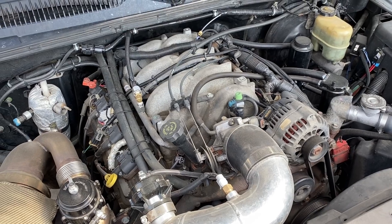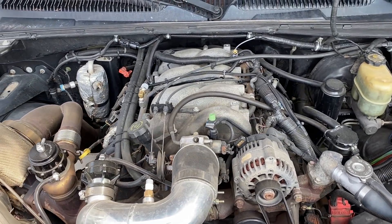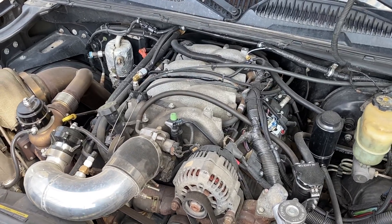Now on to the new part. Much like a lot of other truck engines designed to make a lot of torque at low engine speed, the 8.1 suffers from an airflow restriction at higher engine speeds. If you want to make more horsepower, you need more airflow, so anytime you can eliminate an airflow restriction you automatically gain more horsepower. The first thing most people do is put in a higher lift and higher duration camshaft, which keeps the intake and exhaust valves open further and longer, letting in more air. But the next restriction on the 8.1 is the cylinder heads — the stock heads are basically garbage.